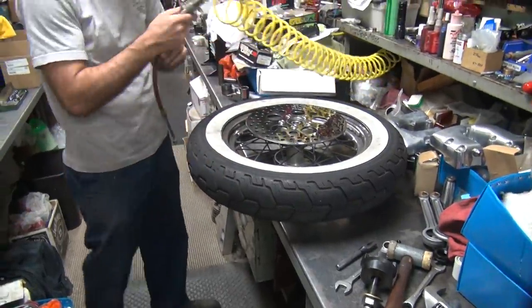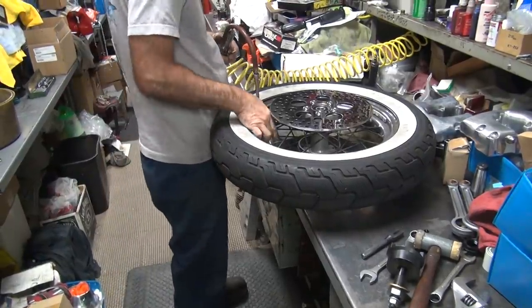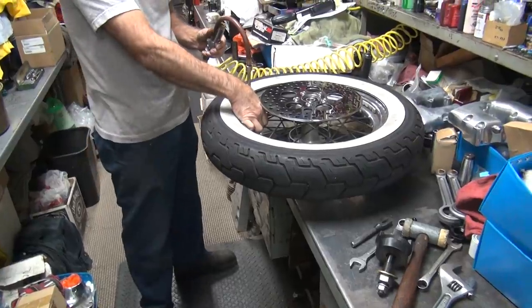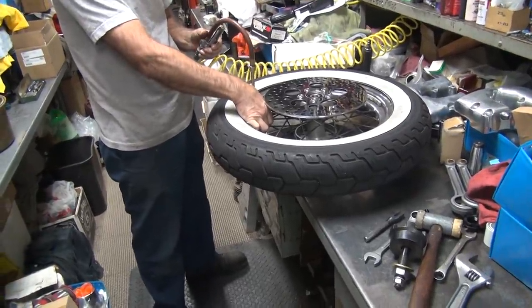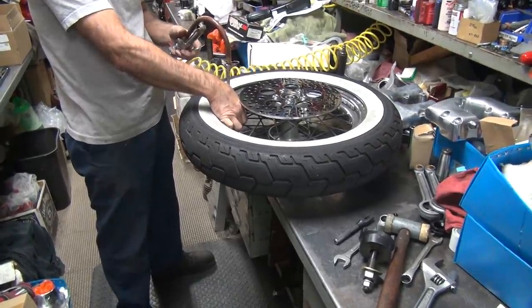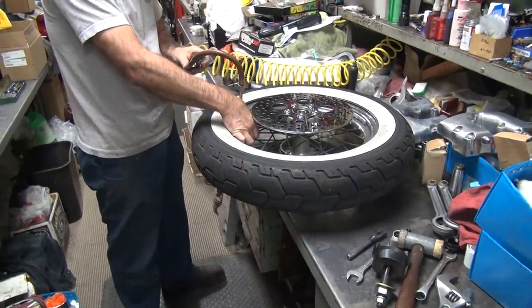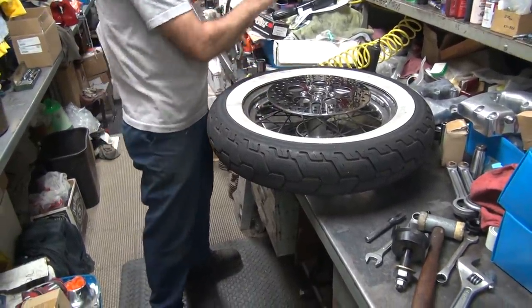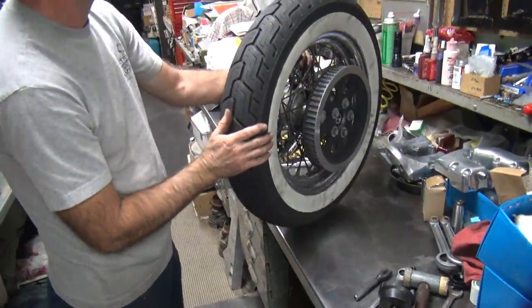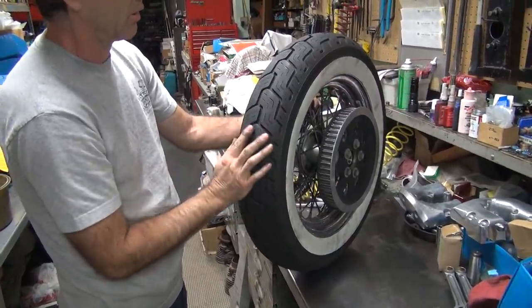But to tell you that, legally, it's hard to argue with what the tire says on the side of it. Makes sense. But if you have a brain, you can figure it out for yourself. Well, how the tire wears. Maybe the tire doesn't wear correctly with 40 pounds in it. Maybe it wants 48 pounds in it. Or maybe it's just wearing a lot in the center and it only needs 30 pounds in it. So you look at how the tire wears.